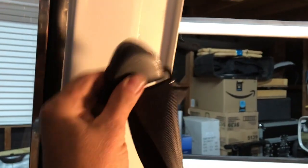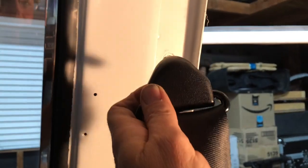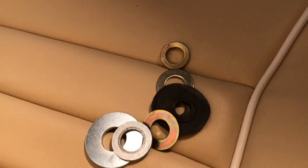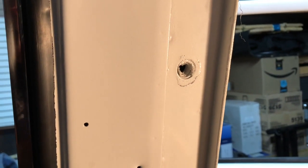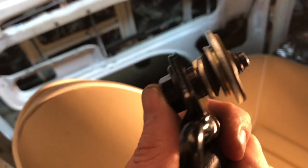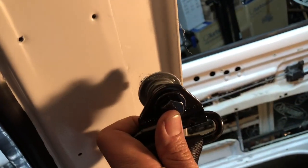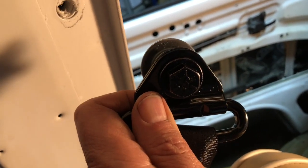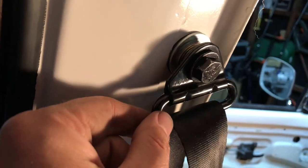So the next thing you're going to do is bolt this piece here to the factory hole — oh, the paint looks crappy, but it's gonna be hidden by this. So you're gonna bolt this into here, but you need to shim it. I'm gonna use this for tonight just to get through so I can drive my bus around a little bit, but then I'm gonna figure out some better shims. I'm also using that black little rubber piece so I don't mess up my paint. So this is my rigged-up deal here — it's got the locking washer, a couple more washers, and then that rubber piece. I also took off the plastic cover so I can get at the bolt. That's screwed on there — got some shims going for now, but I'm gonna get some better shims. Basically you want to make sure that it swivels so that it can adjust to different heights and people.